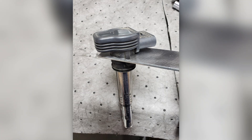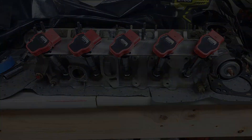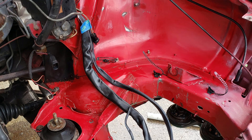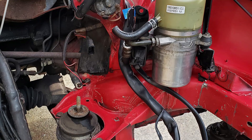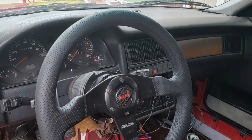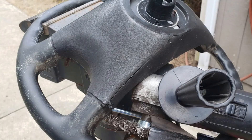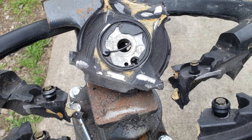Here's more shots of the coil-on-plug system mounted on the head — they'd normally just stick up into space and I don't like things flopping around on a track car, especially with all the weight at the top. Inside the car, I'm using a Volvo electric power steering pump instead of the engine-mounted one, which always leaks. I also had to take out the giant washer bottle. That's the Momo steering wheel going in — I'm also making a shorter hub mount since you can't buy one, so I cut apart the stock steering wheel hub, turned it down on the lathe so it was flat and square.